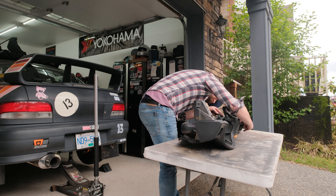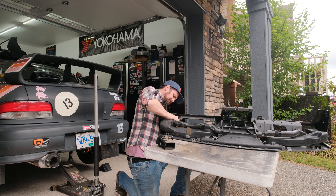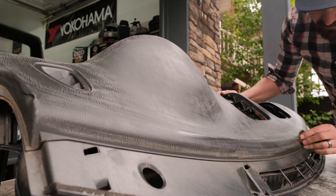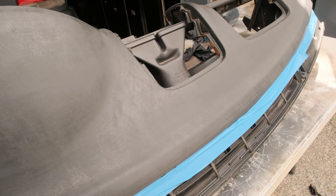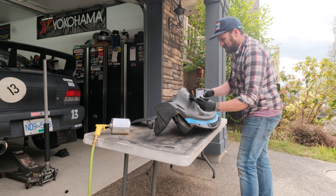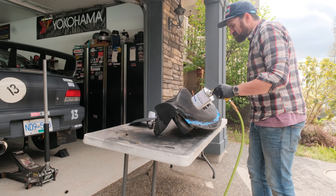Gone — the interior. There's the dash. So I've had this flocking kit in my cabinet since the last Overcrest Rally back in the fall in Oregon. I bought it from a company called Hard Motorsport — same company that made my door cards. The process to get this done is pretty simple after the dash is out: you've got to sand it down, fill in any imperfections like cracks or holes. Included in the kit was this little air gun that you fill half full of flocking material. You hook it up to your compressor at about 30 psi, rub down the entire surface with alcohol, and then you spread out your primer or adhesive. You got to work fast because it sets really quick. Then you go to town with the applicator — make sure you get nice even coverage. If you get any low spots after it dries, you can spray it with acrylic enamel paint and reapply to take care of any bald spots.